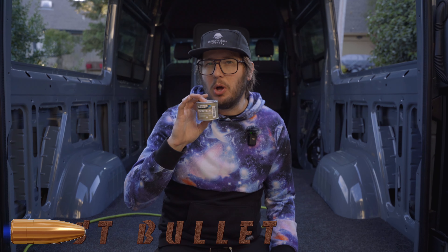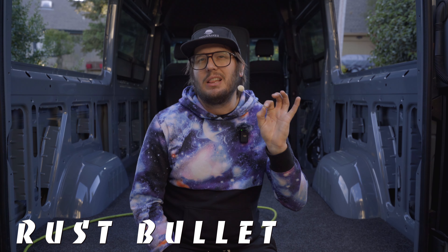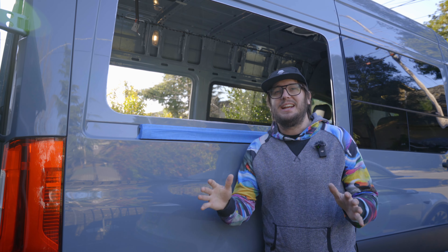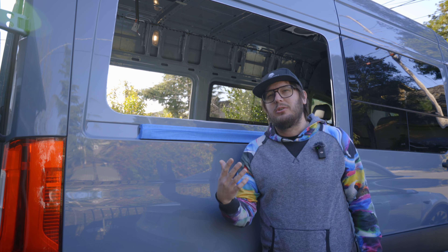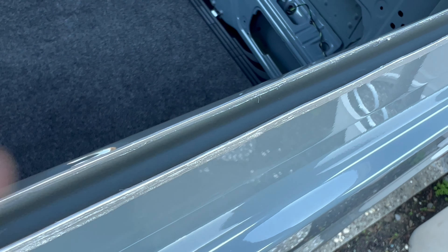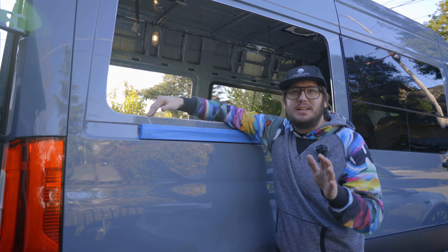We're going to be doing things a little bit differently. I have this small can of Rust Bullet - I'm going to be making another video where I take the panels we just cut out and test a lot of the common anti-rust paints to see which one is the best. This was one recommended on an auto forum, and I'm using it on this project because I just like the name. I've also switched from a foam paintbrush to the dobber. I did two coats, two hours apart, making sure to cover all the exposed edges. Hindsight 2020 - the dobber is not the right tool for this job, as the rust bullet is quite thick and the little strands of wool get pulled out and embedded in the paint. I'm overall really happy with how the Rust Bullet goes on though - it's quite thick and I think it's going to be really durable.